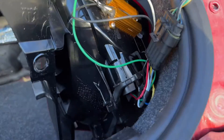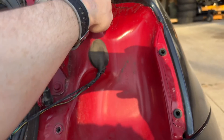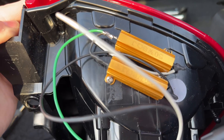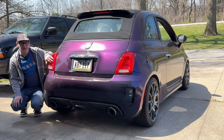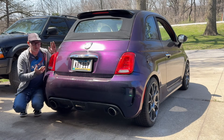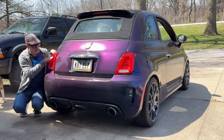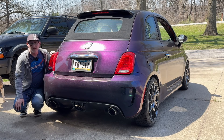What I ended up doing was putting the resistors on the bottom of the taillights — there's actually quite a bit of room right down there. I also learned these taillights are designed so that water just runs behind them, with no gasket, so I didn't want anything attached that would let water in. I used stainless screws and I think I'll be okay. Here's the finished product — it's a huge improvement. I still need to put the inserts in; the factory ones are expensive, just a little piece of plastic with double-stick tape, and I have a 3D printer and a small CNC machine, so I can make whatever I want — carbon fiber or louvered style. But for now it still looks better than the factory ones.